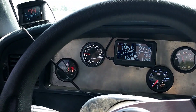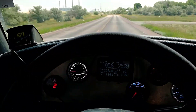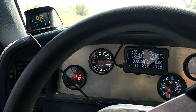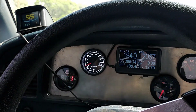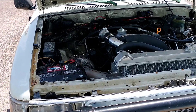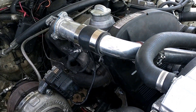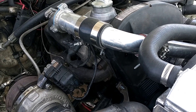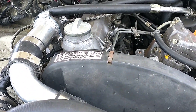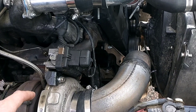I couldn't be happier with this swap. So for anybody wanting some visualization of this — it's pretty sweet. Also, I left out a few things at the beginning: if you haven't watched any videos on this swap yet, this is just a stock 2001 ALH. Nothing's been done internally other than head studs, and I'm actually running 240 injectors now — I was running 260s before with a different engine.